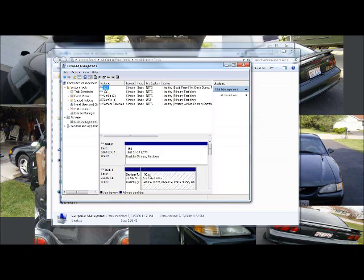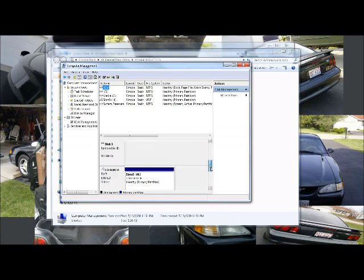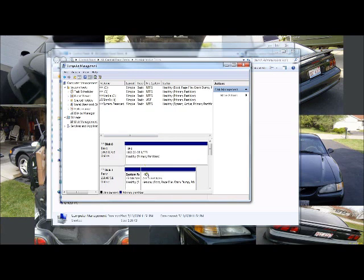When you click on one of those partitions, it highlights that drive and partition below. The Linux-formatted Black Armor drive is easy to identify because it has a bunch of partitions and no drive letters next to them — they're not mapped to your Windows computer. It will show that they're 'Healthy' but you can't map them. If you right-click, the only option available is to create a partition.